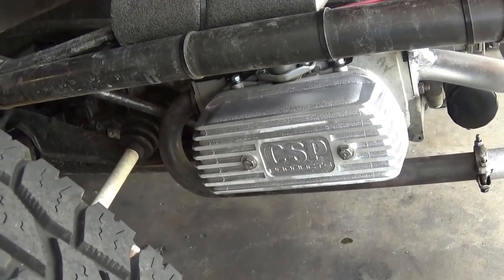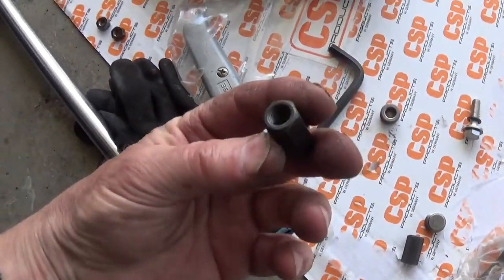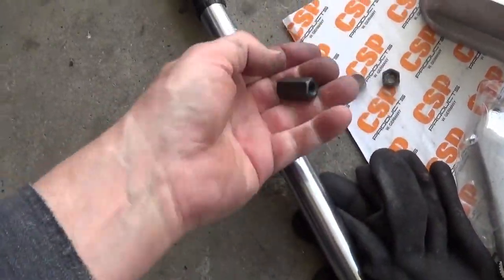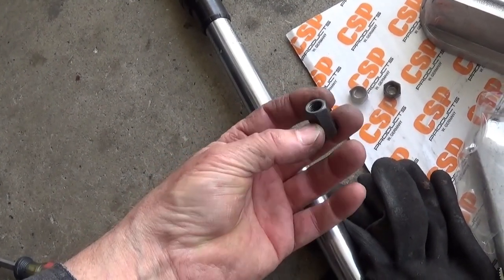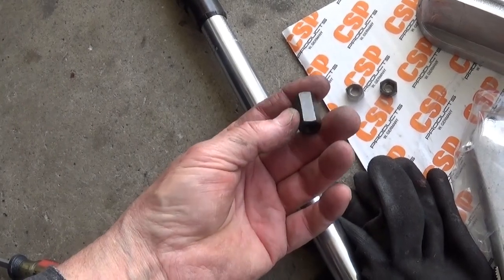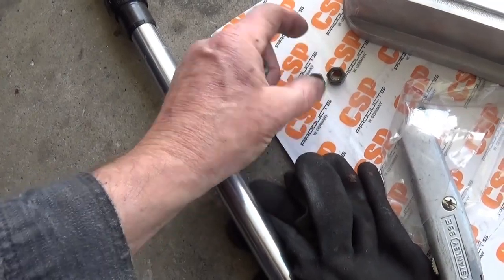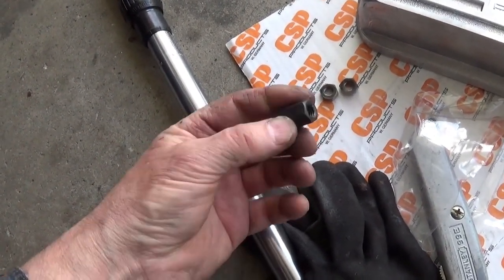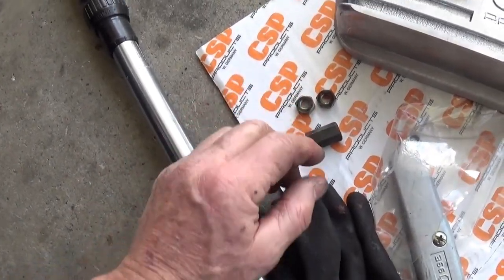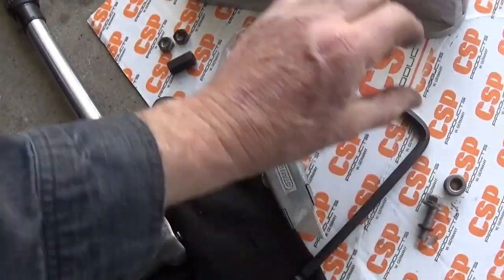You don't just go down there and give it 13 pounds. These you want to torque, because you'll be replacing. I left the wave washers on, put this on top of that, and torqued it down to 18 pounds, just like the book calls out. So the only thing I'm replacing is these standard 8mm nuts with the longer coupling nut. Being stainless steel, hopefully they've calculated it out. It says here they're made in West Germany. I don't know if that's good or bad.